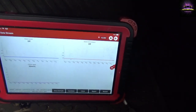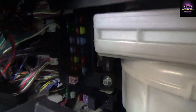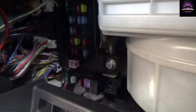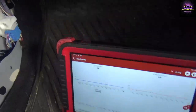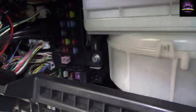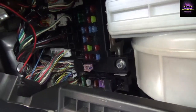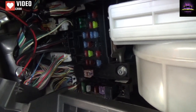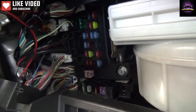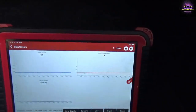Key is on and brake switch is now off. This was the C312 connector — it had a little bit of corrosion on it. I cleaned it out and put everything back together while monitoring the scan tool and multimeter. To sum it up, the fault was corrosion causing high resistance in the harness, which was keeping the brake switch signal on. Now the brake switch is off.